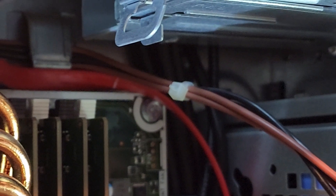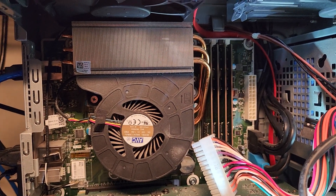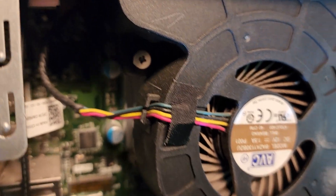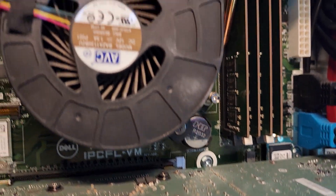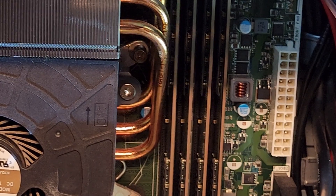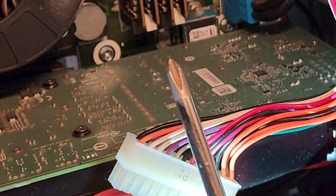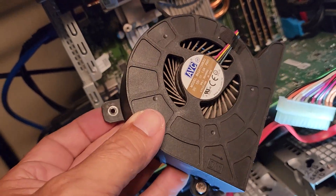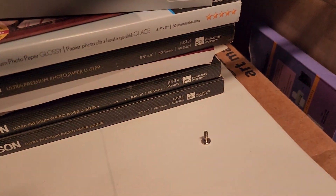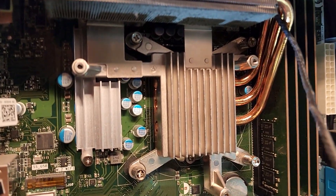I just look stuff up like anybody else. I went to forums — that's how I found out my power supply was too small. Why would Dell give me an underpowered computer and then sell me that sweet graphics card? I don't know. I have to pull this fan off — look, there are three screws to get it off, one there and then one on the left and one on the right. I'm pulling out the big guns — the Phillips head screwdriver, the long one by DeWalt, because it's a good screwdriver with a magnetic tip. Remember, you have to ground yourself. And look, it's out. There's a lot of dust in there — it looks like a little squirrel cage. Save those screws — they're different from all the other screws, so put them somewhere you can find them later.